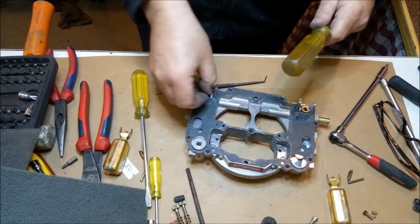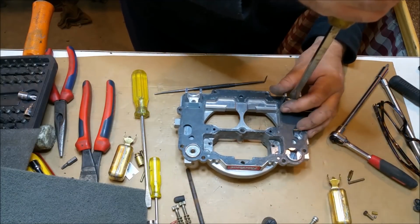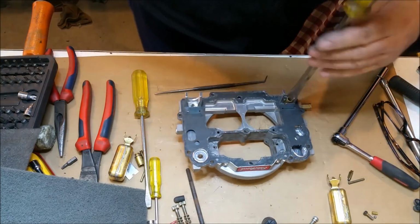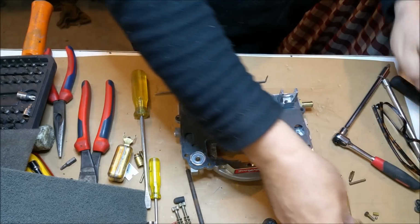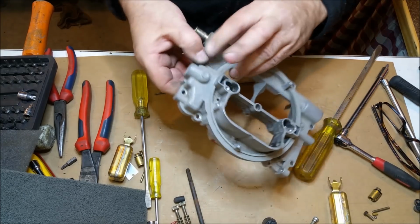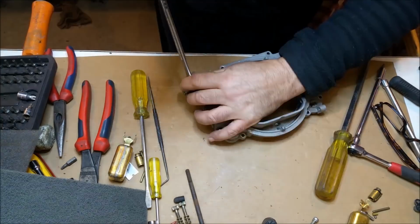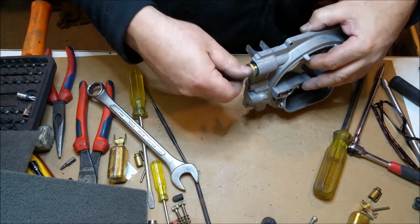There should be a fibre washer. Oh, look, there is. And the side. Just a sec. Let me just push you up. There we go. Same stuff. Fibre washer, needle and seat. Yep, all good. We take that off, which is even sweeter. That's as empty as buggery. I might just pop that out to see if there's a filter or anything in there. Hopefully it didn't break anything.